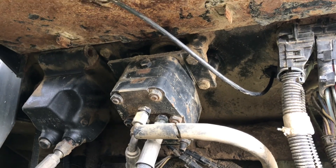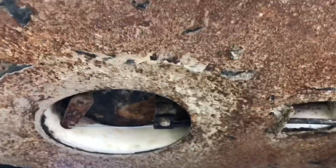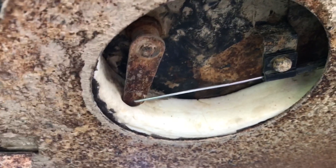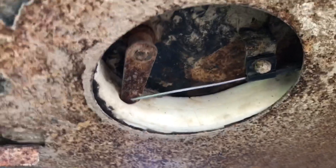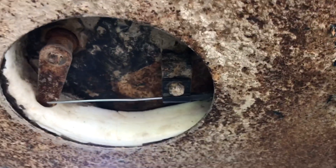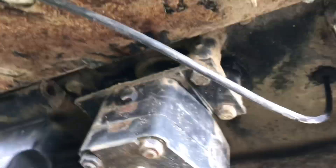Now it's time to go to the outside. I got the cable routed through that square hole into the round one like before. Then I had to hook the wire end first to the dampener. You have to kind of pull it down and push it straight up, but try not to kink it, because that wire will bend real easy. Then you can put the bolt in — I use 5/16 for that as well as the other end. That is the installation.